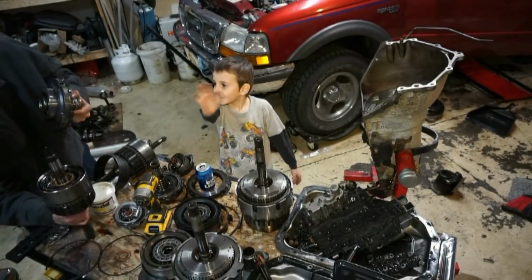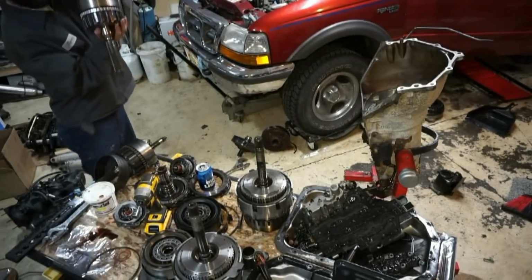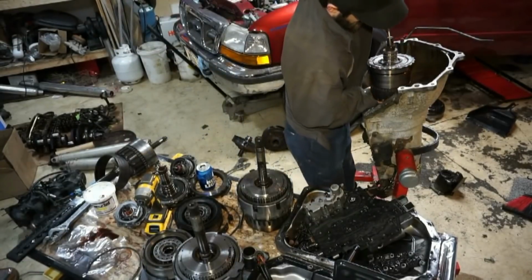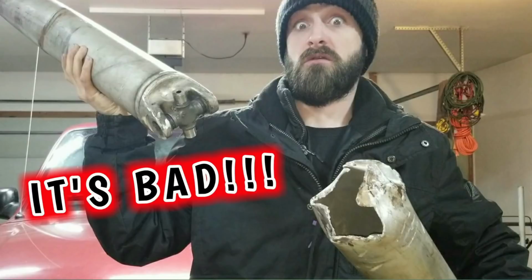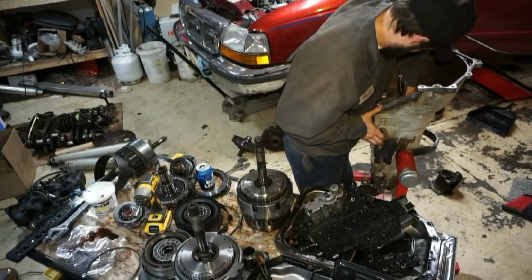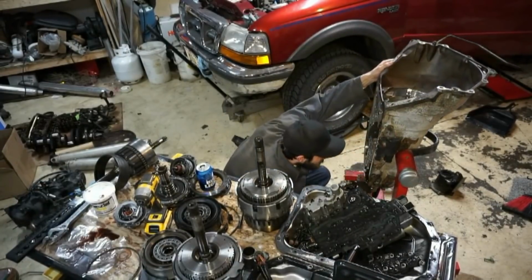This is the first time that I ever rebuilt the transmission, and this little video clip here is the second time that I rebuilt it, because I actually broke the entire transmission. During one of the other long pulls, for some reason the whole thing just exploded. The pump broke, the transmission bell housing broke, the drive shaft ripped in half, and everything was junk except for the internal parts of the transmission. Everything was still good inside, so I just bought a different bad transmission. That's what I'm doing in this little clip: pulling the guts out of the one with the broken bell housing and putting them into the other one, pulling the bad parts out of the other one just so I can use the case.